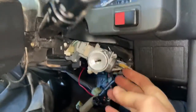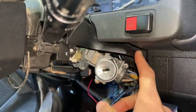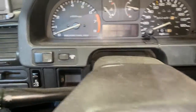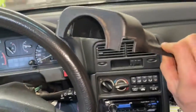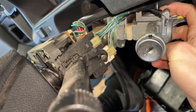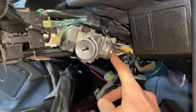You get better access at this ignition switch behind this piece right here, so you've got to get at that screw. It's going to make your life a lot easier if you take off this piece. What I'm going to do is pull this little steering column tilt lever down — that lets me lower my steering wheel as much as I can — then pull that column back up, and this piece will just slip off like that. Now we've got a lot better access at that other screw.